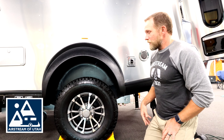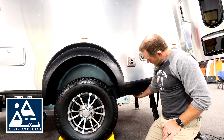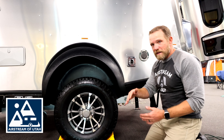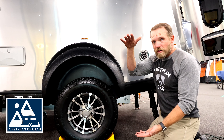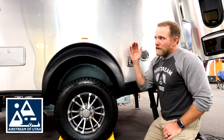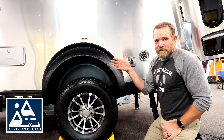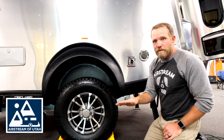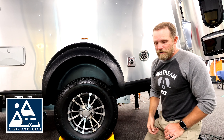So that's problematic. You've got roughly 21 inches right here, so you need a jack that's going to get you up that tall, plus enough to get your wheel off the ground. In your normal travel trailers, the dual axle type, and the lower standard-looking Airstreams, they are a little bit lower, but they still have to come off the ground quite a bit to get the tires off the ground.